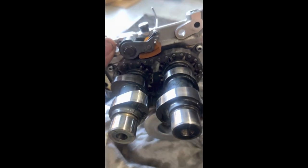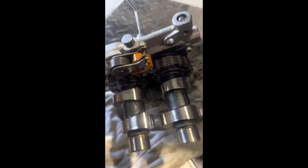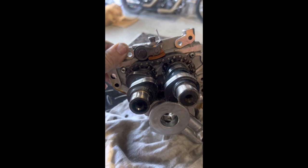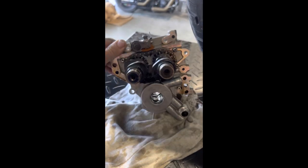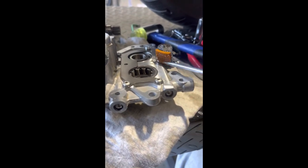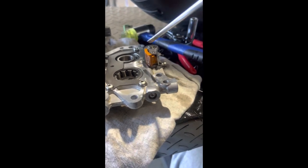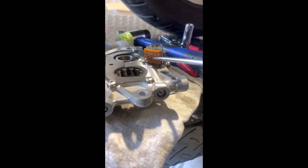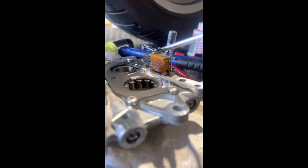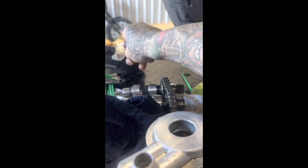Back to the cam plate — on the cam side we have got a lockout hole to pull that tensioner up and lock it out. We can slip our cams and everything out, and then we'll continue on to put some new material in here, some new parts. Cams are out. So that tensioner there is for cam gear to gear, keeps everything in time, keeps some pressure on. We can see on the face just how deep it is starting to come in — so it's done its job up until this point. We'll update this now with the Daytona product from Rollies — replacement chains and tensioners.